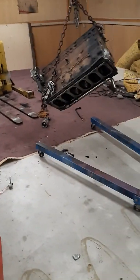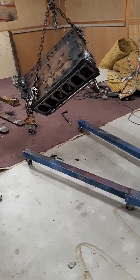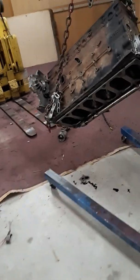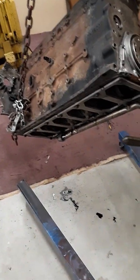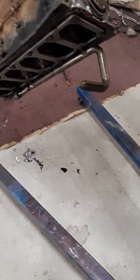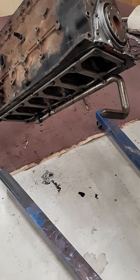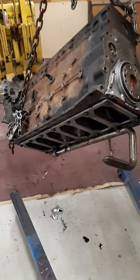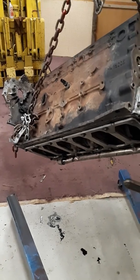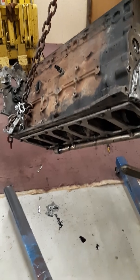I always do this with a scan tool as well so I can watch fuel pressure while cranking. On no-starts I usually see about 600 PSI while cranking. Sometimes blocking one off will get you to 1,500 PSI — closer but not enough to start — which tells you there's another one that's partially bad too. It's hard to get away with doing just one injector at a time. I've done the same thing myself — replacing one injector at a time with used ones I had lying around, just trying to get by and get to work the next day.